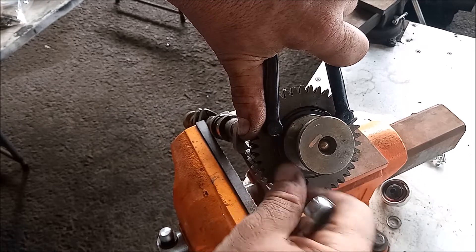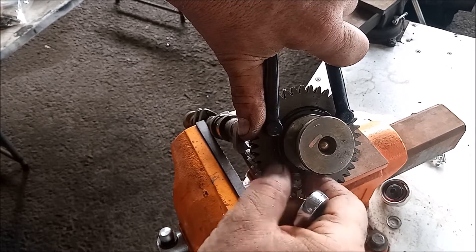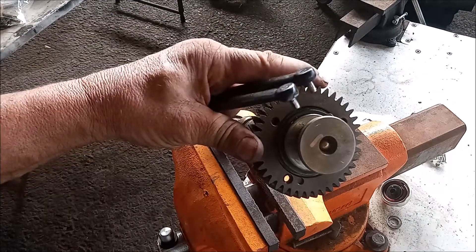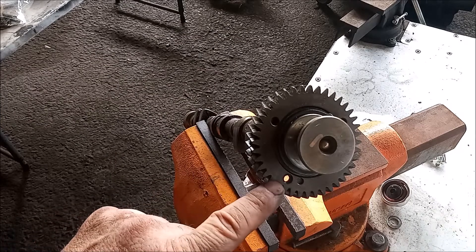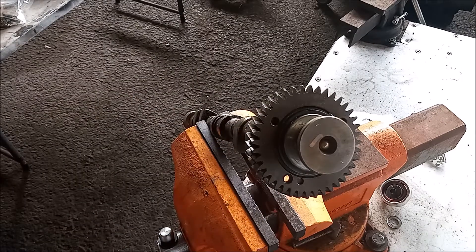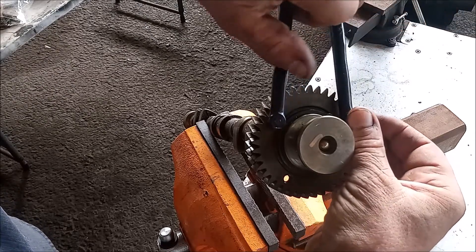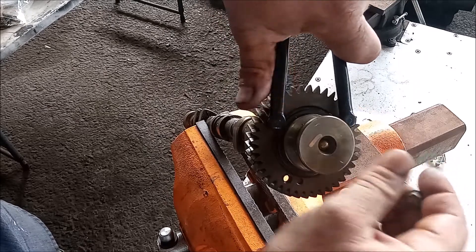Now this shows you the position that the cam will snap back to if the spring tension is released, and it looks perfectly fine. You might be tempted to just install it back this way, but that would be a grave mistake. To reinstall the service bolt, you take the pulley plier tool again.